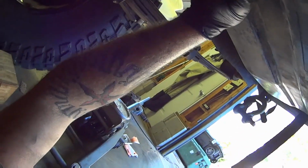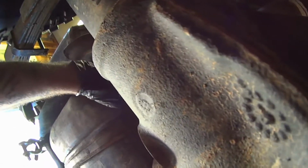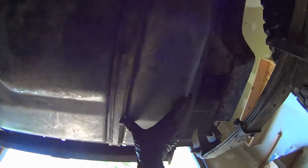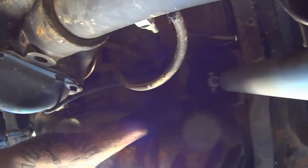Now these hangers just look like that on one end. You just push these up and put them in their little groove up there. This is that notch I cut out of the heat shield. Go around that and almost. Alright, so that hanger's in place. The tank could go a little more driver's side, but it's pretty lined up. And that hanger is in place.